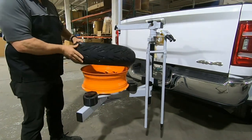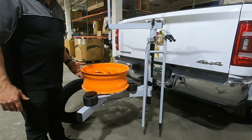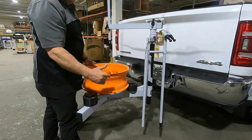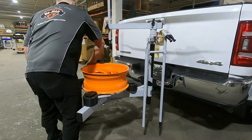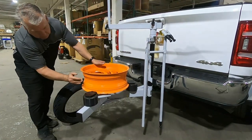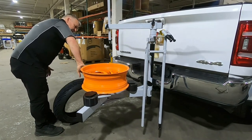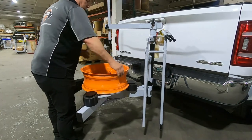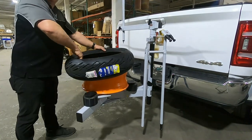Time to put the tire on. I'm using the same tire. To install, get the stem somewhere between six and seven o'clock. Take the lube and spread a little in your hand, then run it through the wheel all the way around — this is the drop center. Just a skim coat, you don't need a lot. Apply it to the top edge of the wheel between ten and two o'clock — these are your high-friction areas — and on the inside of the tire between three and six.